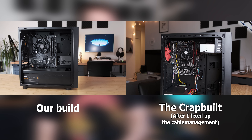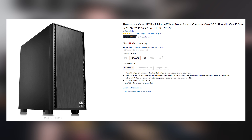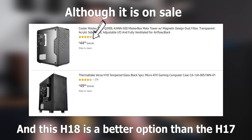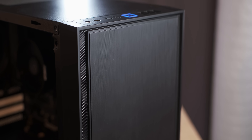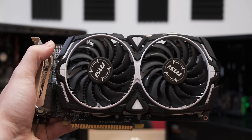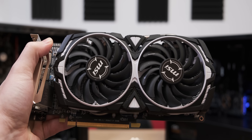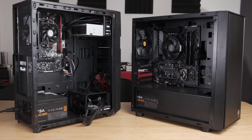Just like that we've finished our competitor to the Amazon crap build and I think it looks really good. Eagle-eyed viewers will have noticed this case isn't the same one we started with — that Deepcool case really sucks, so I went with this Thermaltake H17, which is the same cost as the Cooler Master case linked in the description. I really like the H17, although the front airflow is really terrible. It's fine with only the APU, but the moment you upgrade to a dedicated graphics card it can't handle the heat, so I'd recommend the H18 version which has a perforated front for way better thermals.